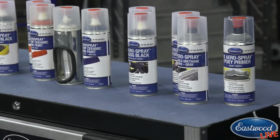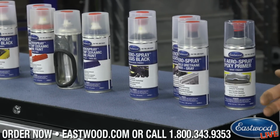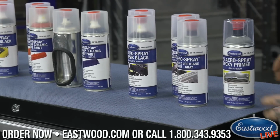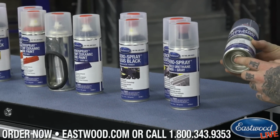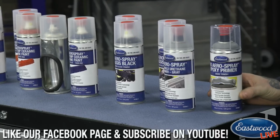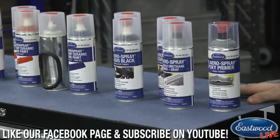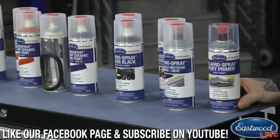be able to touch the vehicle for a little while, instead of having to pull the paint gun out, mix up Epoxy Primer and spray it to seal it up, what you can do is activate the bottom of the can here, spray it, seal up the area that you need, and you're good to go. And you can just recycle or throw the can in the trash when you're done.